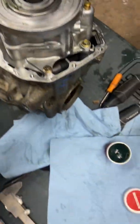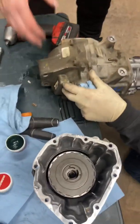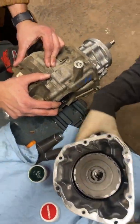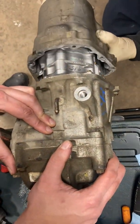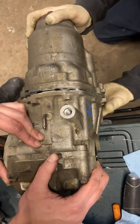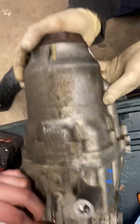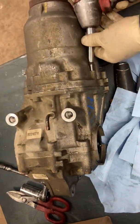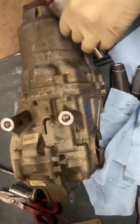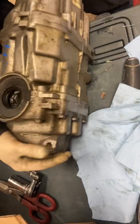Now this is the tricky part — putting this on without that cover falling. Like I said, this is kind of easier with two people. Pretty much it's ready to be assembled. You're going to Honda bond the flange. What I like to do is hold the diff at a slight angle down while I put this on, because this plate is loose. What's holding it is going to be the washer over here. So basically I just slide it down at an angle and kind of twist it. Once it's in, you can smack this back on the table and torque it all down with the screws. Now look — this spins here and it's sending it to there. And there you go — that's how you do the ramp style lock.